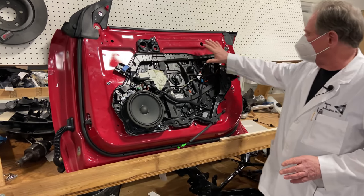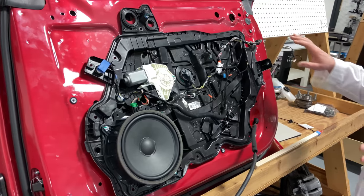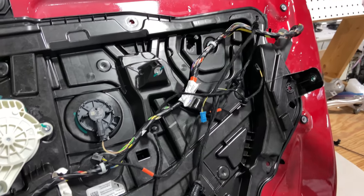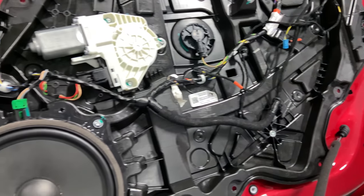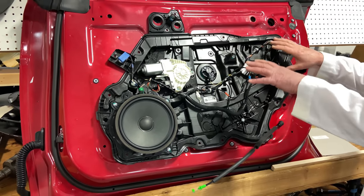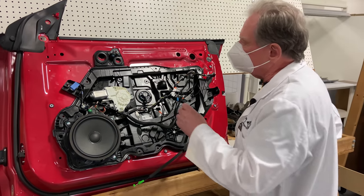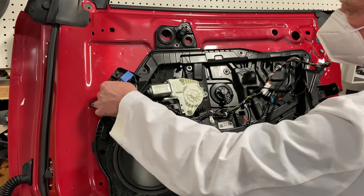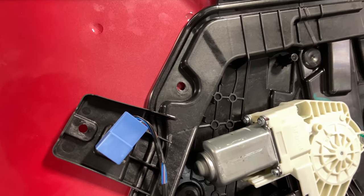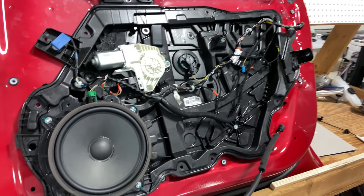You start out right here with what we call the substrate — the plastic substrate. You can see that all the little connectors and whatnot can all snap right in. That's a cool idea — saves the operator a whole bunch of time. Besides, this is made offline, not here at the door. It's made somewhere else and then brought in and fastened down. They also thin out the areas where there doesn't have to be as much strength, which is a great way to reduce the cost associated with the plastic components.